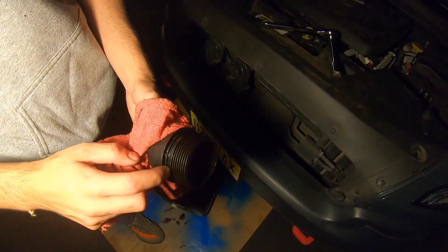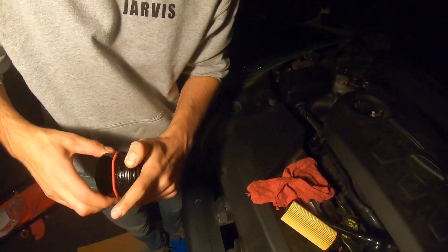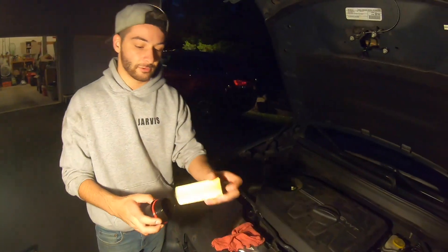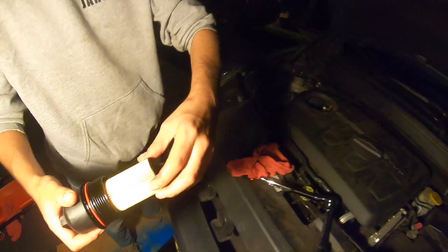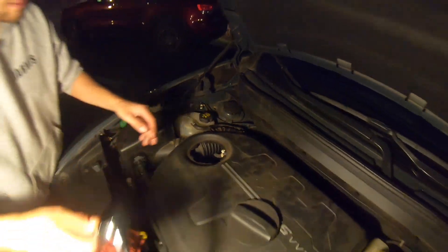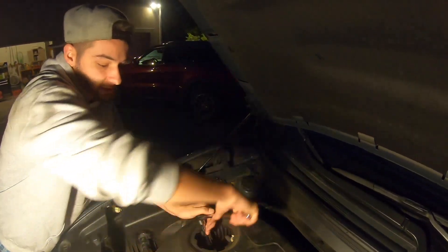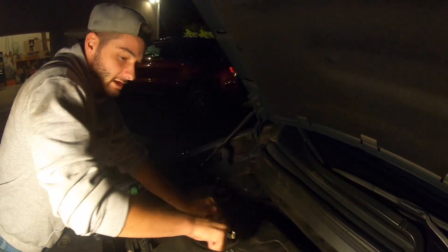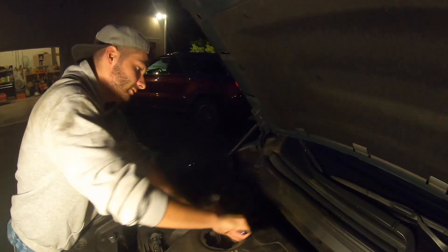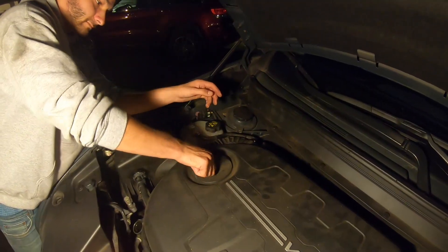There's an O-ring down here — definitely replace it. We're going to put the new filter in, then the O-ring. I'm going to put the O-ring on first — just a little bit easier. Make sure you get it in that groove, because if it's on a thread it'll sit cockeyed and you'll leak oil through it — and oil is expensive. Then hand-tighten it first and then tighten it up with the tool. Be careful not to over-tighten because it's going into a plastic housing and if you crack it, it could be a nightmare. There's a torque spec — I'll put that in the description. Those grooves go in and then you just twist it to lock it in place.